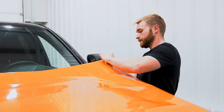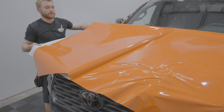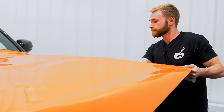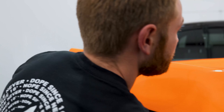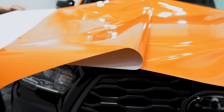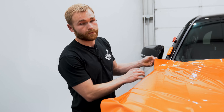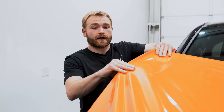I'm going to start over here in this corner. Going to peel the vinyl off the backing paper just a little bit, take this and flip it around. In this corner we're just going to tack this so the vinyl does not come off the vehicle when we don't want it to. Once you have one side stuck, you can remove your magnets — it makes it just a little bit easier so you can actually lift the film up. We're not worried about any creasing underneath because we're going to pull all of that out in just a second.